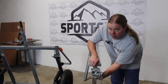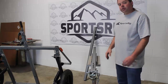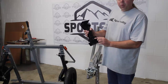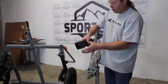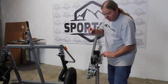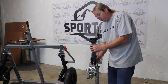I put a little dab of anti-seize on all my threads — it's great for plain bolts, especially stainless. If you do put the stainless hardware on the trailer, it definitely helps from anything locking up on you. Now that we've got these sucked down nice and tight, we can put on our jack stand. The way the jack stand works — this is the down position, you pull that out and it locks into these grooves, and that's going to be the folded position. We want this tongue portion facing away from the cover, so you can just put those right over the top of those other bolts. We have the washer and nuts provided — thread them on. To get this back one, I like to pull it off to get access. Put those washers and nylocks on there and tighten them down.